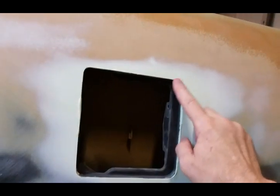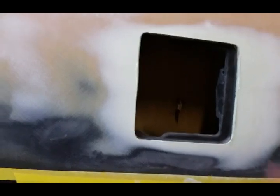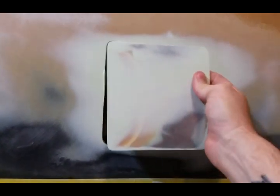This turned into a mess. I was basically going to panel paint the gas door — just paint the part and bolt it on. I'm glad it worked out because the gas door didn't even have the right crown at the back. It lined up here and here and down here, but up here it was out a little bit, so I had to bend a little more crown in it to match up right. I ended up using a two-part pull putty — with the gas door on I basically wiped it all, went back and blocked it, and this is what stayed. All this around here was low.